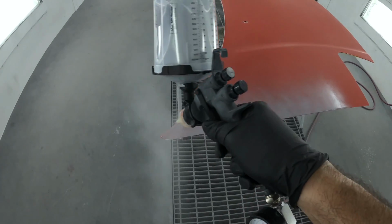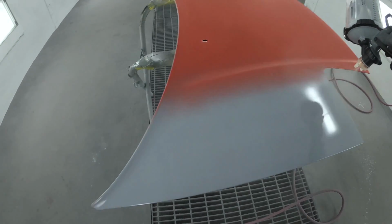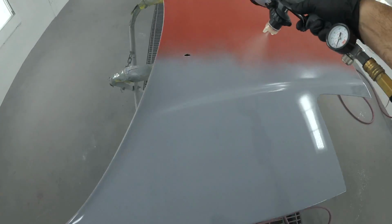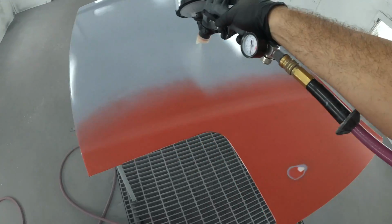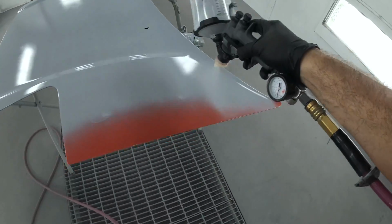Now, what he did is went ahead and took as much as he could off of the car and got a full primering. Now, these panels underneath, you want to make sure they're all taped off, which they are, so that overspray doesn't come along on the other side, because a lot of these parts actually are painted and cleared underneath. They're not like new cars. They actually look nice underneath the panel. So he's going to go ahead. He'll put 2 good coats.